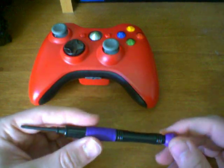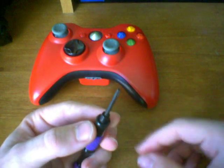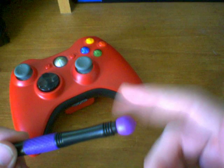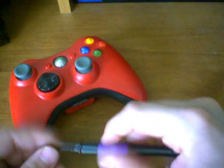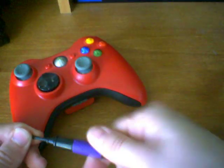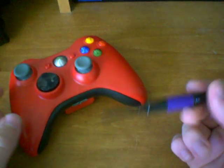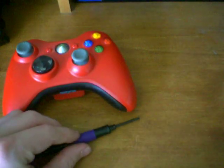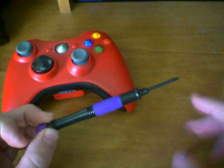This screwdriver I got off Amazon.com — I'll put a link in the description box. It's specially made for the Xbox 360. It has the T8 bit with the security hole and it is extended and very narrow so that when you fit it into these deeper holes it reaches without a problem. It comes with a little grip and a circular ball that kind of free floats on it, so you're able to turn the screwdriver while still maintaining control by pinching it between the flesh of your thumb and your other fingers, which makes unscrewing nice and fast because you don't have to let go and reset your hand every time. It also has a slightly magnetized tip which helps keep screws from falling off. Out of the two options, I would recommend buying the screwdriver made for the Xbox 360.